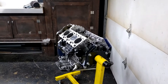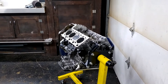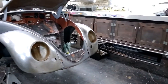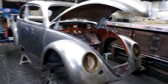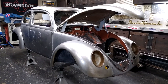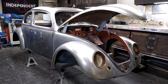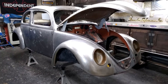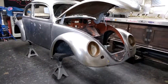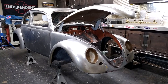I'm prepping my motor, hoping to be maybe a week or two out before they're ready to ship my chassis to me, and then however long it takes to get here. From there I'll assemble the chassis, which all comes in a box, then test fit it and do any metal fabrication that I need. I'll probably fit my wheels at that point — I'm going to widen out my fenders to fit the wheels, trying to fit maybe 12-wide in the rear and probably 10 in the front.